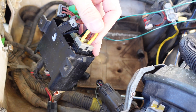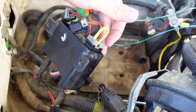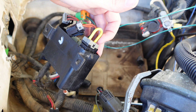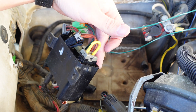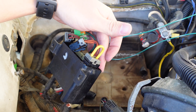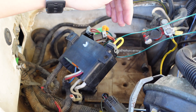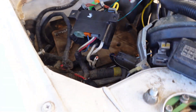You can see this yellow wire right here — it's actually supposed to be black, because I did go ahead and blow that fuse when I was replacing my alternator. This is the alternator fuse, and I grounded out a wire and blew it. I've just replaced it with this, which is not the correct gauge, not the correct fuse size, and not the correct type of wire. So it is just not a good thing all around, and you just can't replace them very easily.